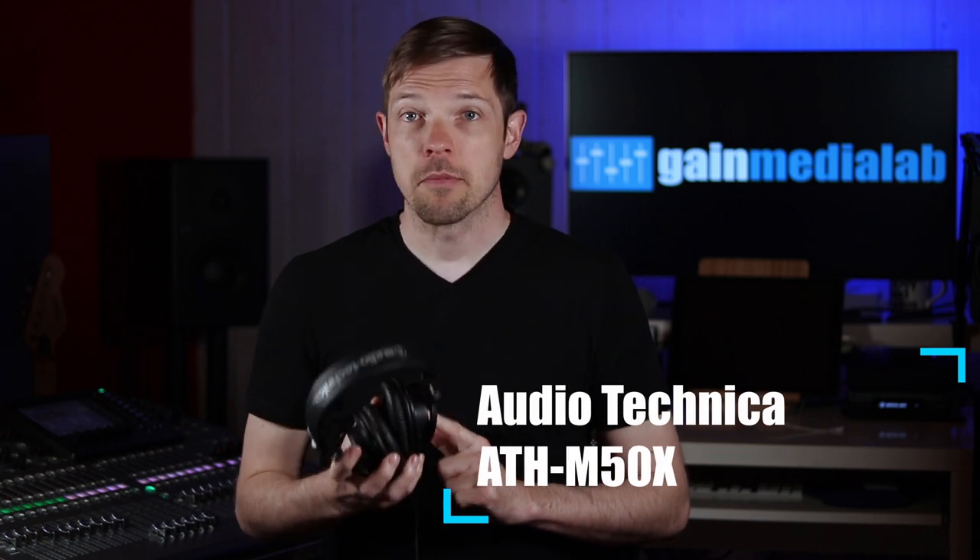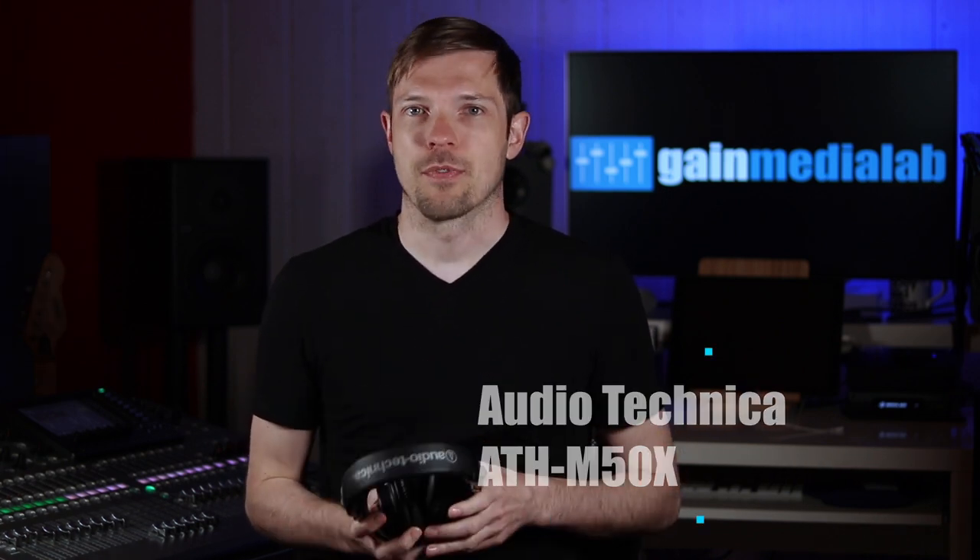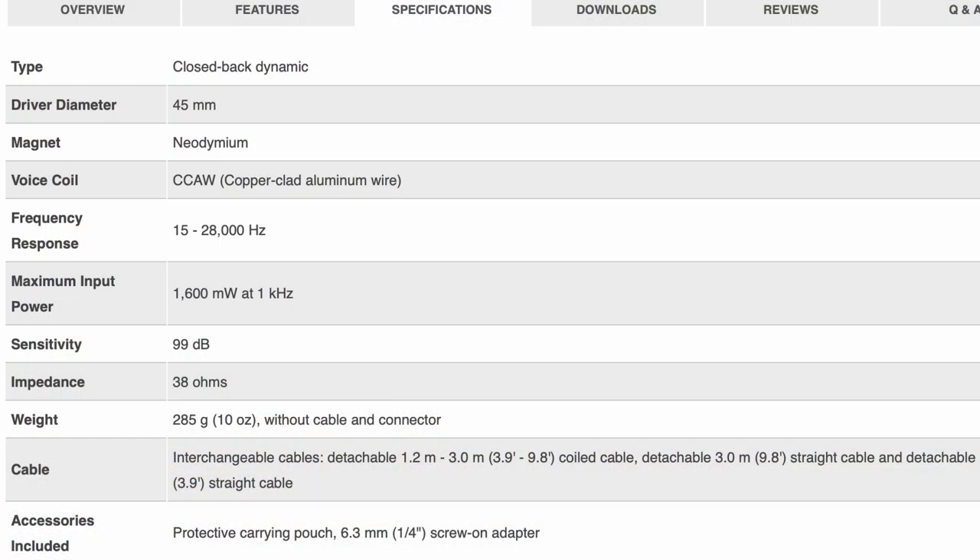After all that, I think it is time for me to reveal my model of choice. These are Audio-Technica M50 headphones, a predecessor of the current M50X model. They tick all the boxes for me. They are closed type with a large driver. The cushion has a great seal and is extremely comfortable, and these can get swapped out quite easily. They have a great frequency response and with an impedance of 38 ohms, you can drive them really loud with just about any headphone preamp. The new model M50X only weighs 285 grams without the cable.